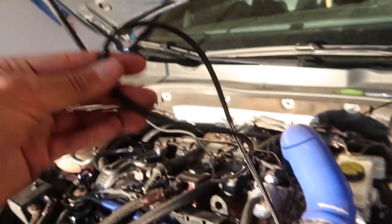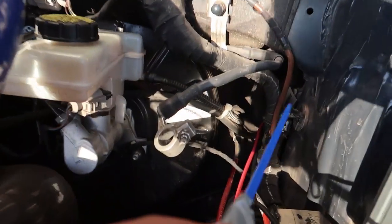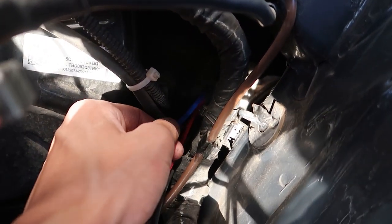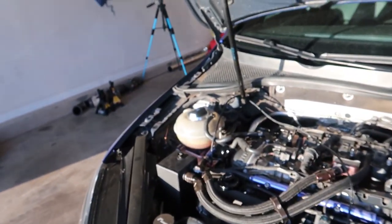I'm making two videos at once, so I apologize. The battery tray's out, intakes out, and right now we're doing the wiring for the PM4. While that's out, we're using the same grommet to get the USP ethanol harness through — it'll go here into my sensor. I took the end of it, put it to a zip tie, slipping that through there — my boost reference and power and ground for the PM4 are also going through the same grommet. Hopefully it'll just stick right in and I can pull it out the other side.